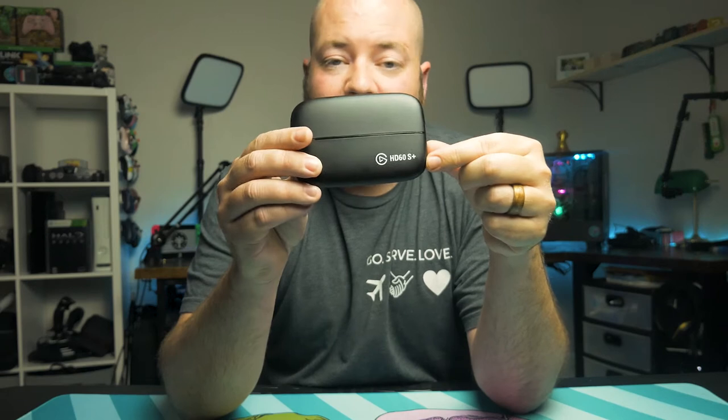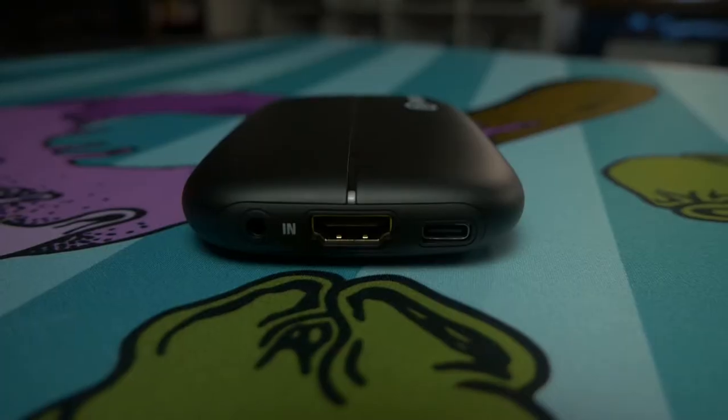As far as the form factor, these two devices are the exact same. The only difference is the labeling — one has S+, the other just has HD60S. This is an external capture device, which means it has an HDMI input and an HDMI output. It also has a USB-C connection to connect to your computer. On the inputs, you also have a 3.5mm jack input that allows you to input analog audio to the device. So if you're using something such as the Elgato Chat Link to capture party audio from your Xbox or PS4 controller, you can plug in a 3.5mm cable from your controller or headset to grab that audio as well. You will need to set analog audio instead of HDMI audio in your software so that you're capturing the right audio — otherwise all audio is going to be over HDMI.